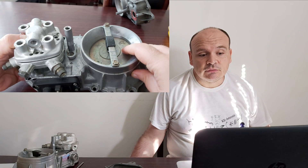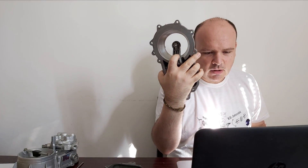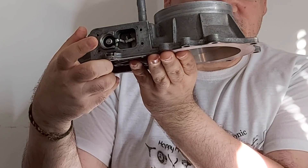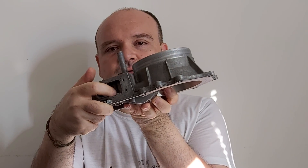At the very end you have to deal with the mixture screw. If you can't get the plate play, don't try to get it at any cost, because you will have to disassemble the whole airflow meter. You will have to disassemble it — look at it. On K-Jetronic that's not such an issue, but on KE you will have to deal with many issues. You will have to clean the unit and remove the potentiometer.